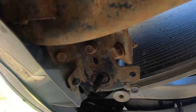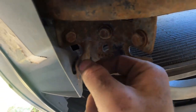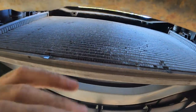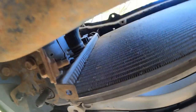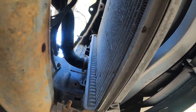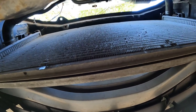Now we've got those bolted back in — they're 13 millimeter. Taking them out releases the whole bracket, and then you can pull the pin out as well. That got our fan out. If you have a new one, just put it back in, plug it back in, and you're good to go. Make sure it sits inside there properly — push it up to separate it from the radiator and it'll slide right out just like before. Since these fans go out a lot, we're buying a cheaper fan, just a fan, and zip tying it to the radiator. It'll do the same thing.